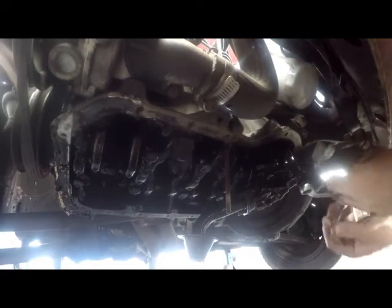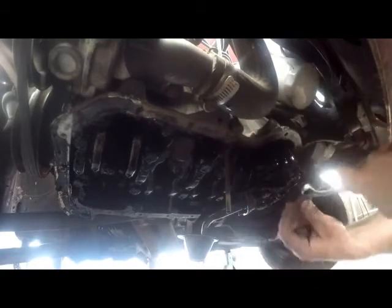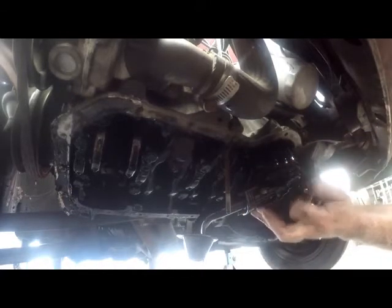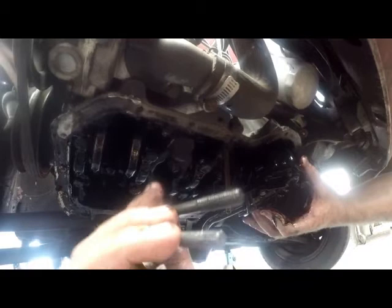We'll remove the oil pump as well so that we can give it a good inspection. We need to take a look at that sieve to see if there's any blockage. The pump just comes off with two bolts — basically 13mm heads. As you can see there, the pump is off and just slides out. Looking inside the sump, you can see the sieve — there's definitely no blockage. The sieve seems clear.